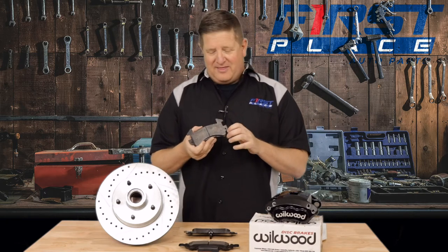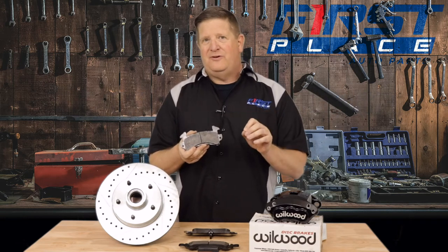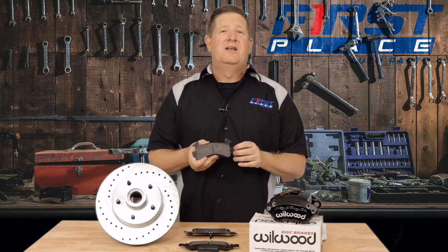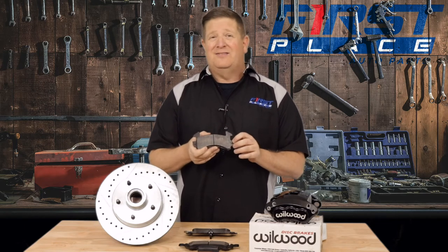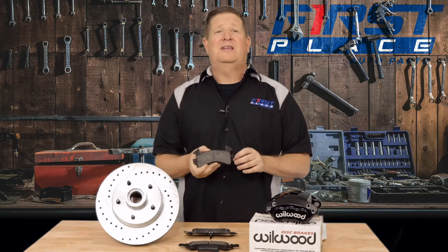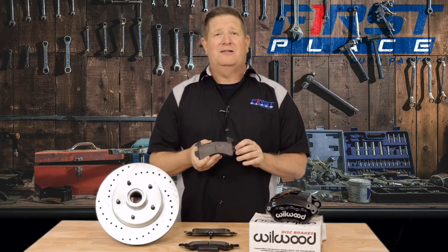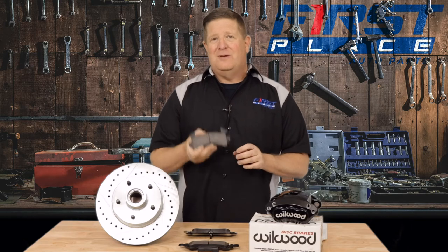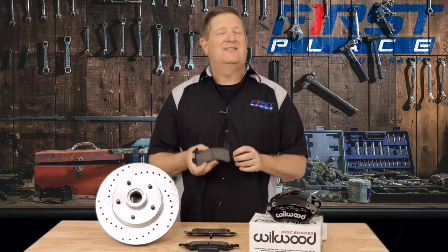Because of the metal makeup in these brake pads, they are far less compressible than either of the first two types, so the pedal feel is fantastic. It feels as if you're getting more bite for every pressure you apply to your brake pedal. In my experience, I put a set of these towing-spec brake pads on my Ram truck where I routinely pull either a car trailer with two razors on it or dirt bikes. The brake pedal effort is much less with these semi-metallics than what came on the truck originally, which were organic brake pads — my truck stops without even thinking about it. And also when I'm towing my boat down a hill, I have zero brake fade. I'm also not getting that smell from all the resins baking out of the original brake pads.